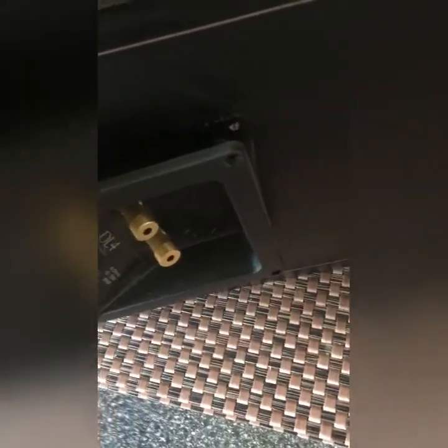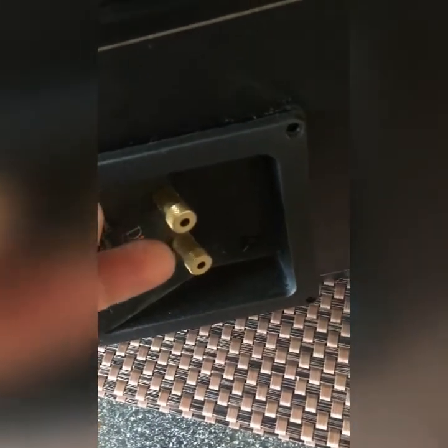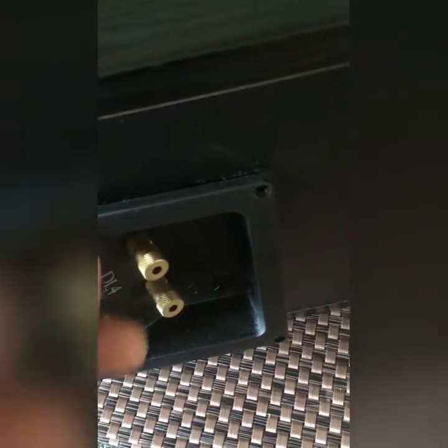So investigating the rattle — I've done the screws on the rear terminal plate. There's this little mod I do to fit these so you can put banana plugs straight in rather than the original Celestion ones, which didn't have the holes, so you'd have to put the bare wires or the banana plugs up through the binding post. That little mod makes things a lot easier.